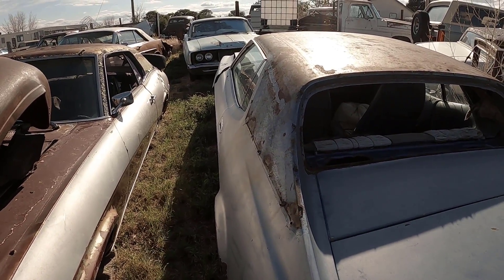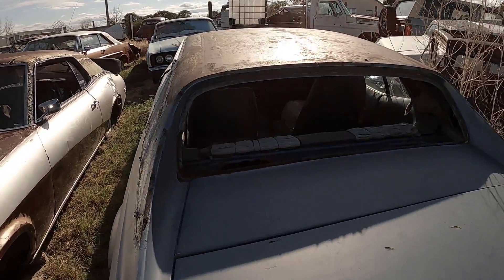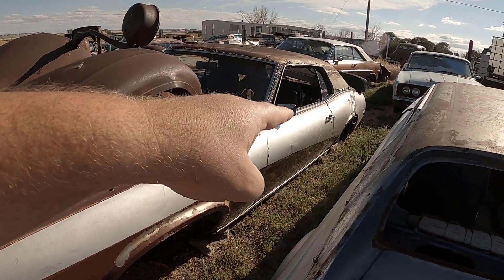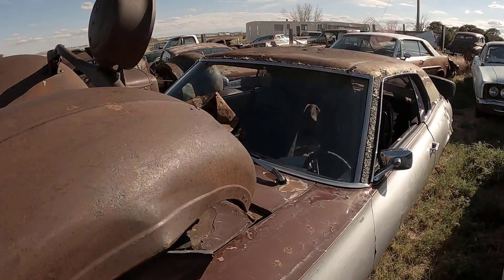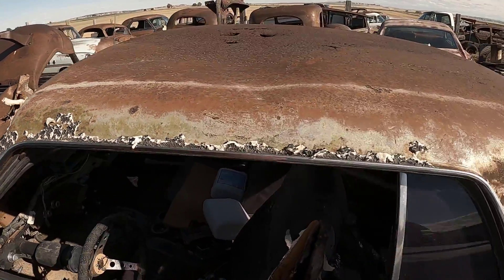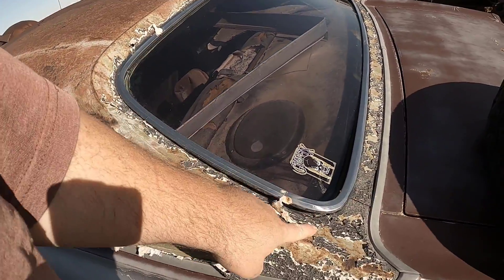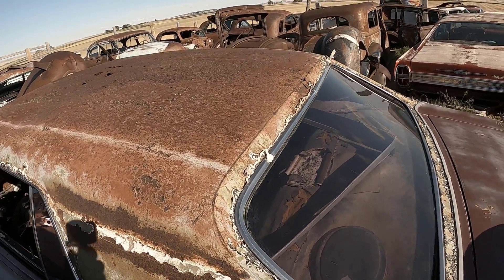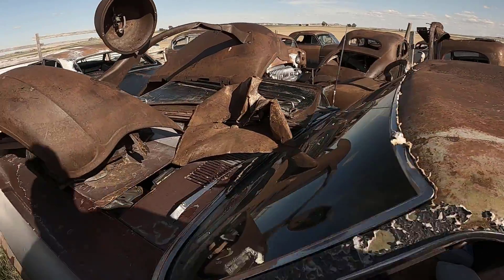The oil pan seal is back ordered for the 351 Cleveland, which is kind of shocking, so I just gotta wait patiently for that. I need a few floorboards, a rear fender, and a roof — I'll scrape it all off and fix whatever holes I may find. I'll just skin it once I get around to it, and whatever little tiny holes are down there I'll sand and then weld in, or lead. We're not going to use any body fillers — we're going to lead everything the old style.